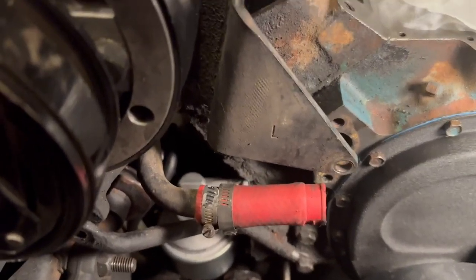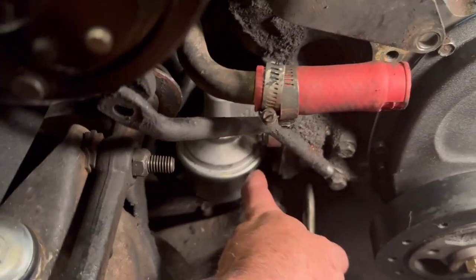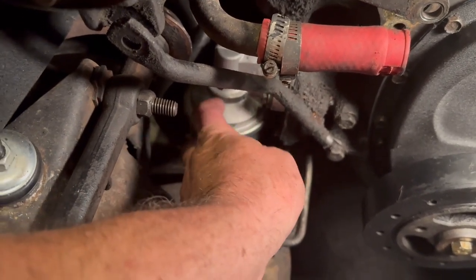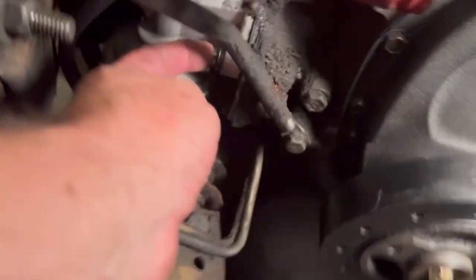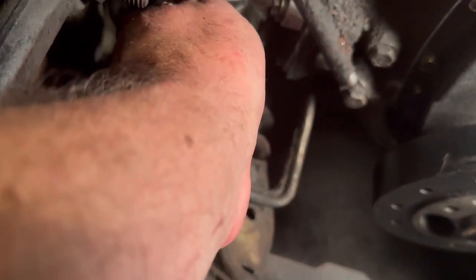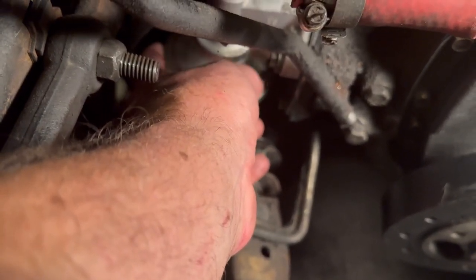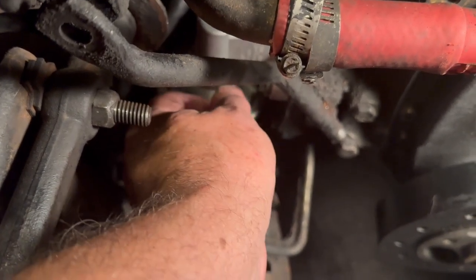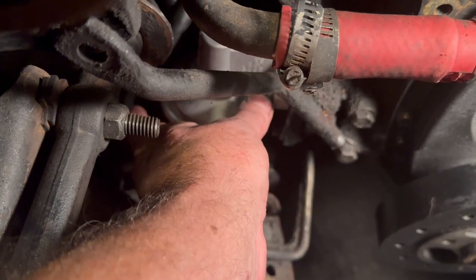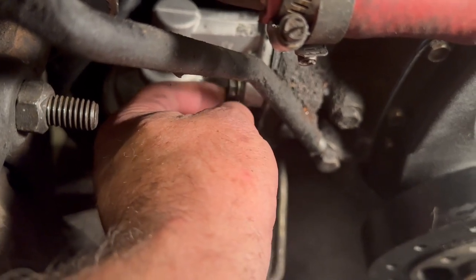There was no way I was going to be able to set this phone up so you could see what I was doing with two hands down here. But I got the rod in there and made sure the pump arm was underneath the rod. I put the upper bolt in through the gaskets and the plate, and using one hand I pushed the fuel pump up into the block. With my right hand I threaded and got this bolt started, took my wrench, held the pump in place, and brought this bolt in. Then I got the other bolt on the other side started as far as I could with my fingers.